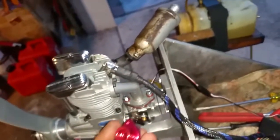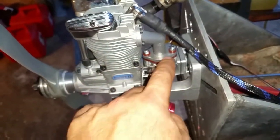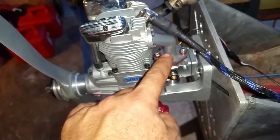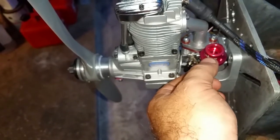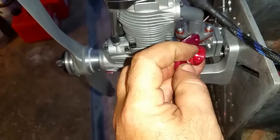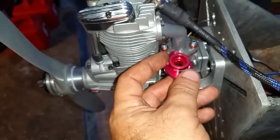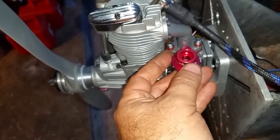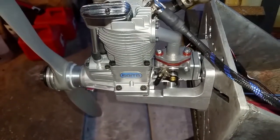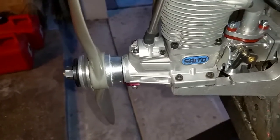Here is the adapter — the carburetor gets mounted on this side normally. What needs to be done is this flange here has to be cut really close and maybe touched with a file. Then this part goes right here like that. It gets in the same place, goes up, and has two set screws. Before you put it in, it's good to put some JB Weld or RTV to seal it better. Put it in a position that's better for your throttle linkage, tighten the set screws, and let it set. With those modifications there have been no complaints — they were happy the engine didn't stop.